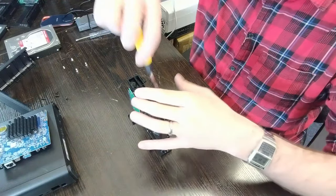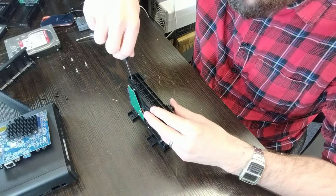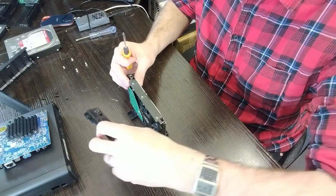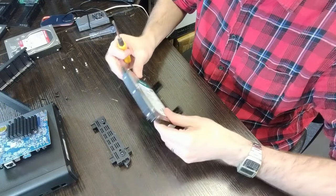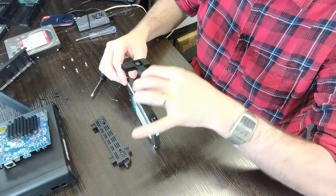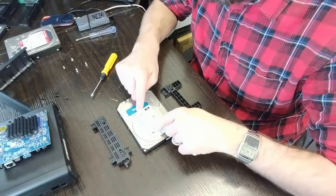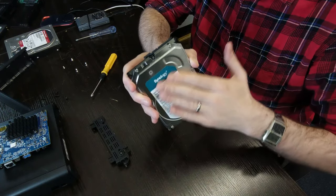Now we've got our storage drive — the original 4TB drive. Remove the four rubber screws on the sides. When you remove these, strongly keep track of which side is which, because installing the wrong clip on either side in the wrong direction will be very detrimental to the inside of the system. These are countersunk screws so they will stay inside the tray plate. We've now removed the casing of our drive. If you're going to keep your original drive, store it somewhere safe — all the data remains on it.